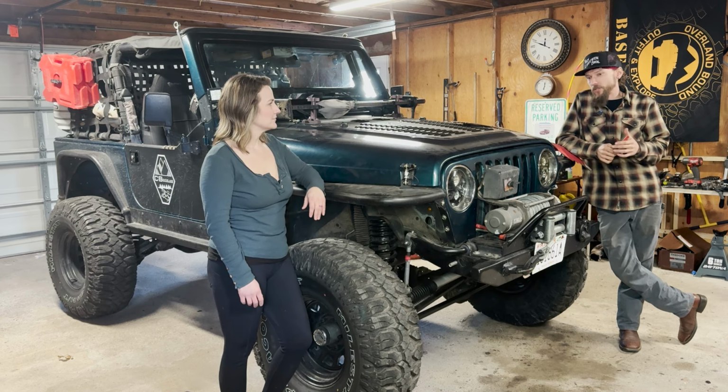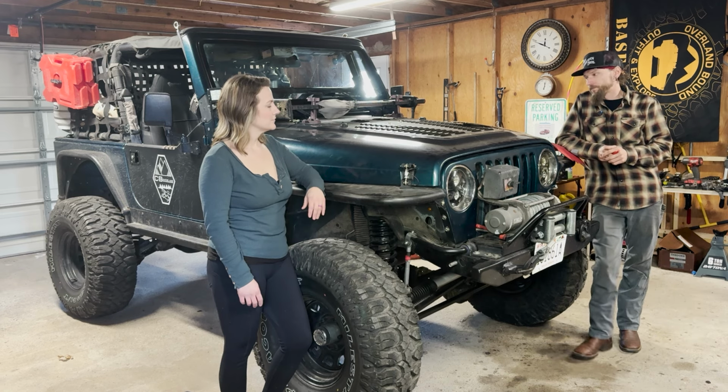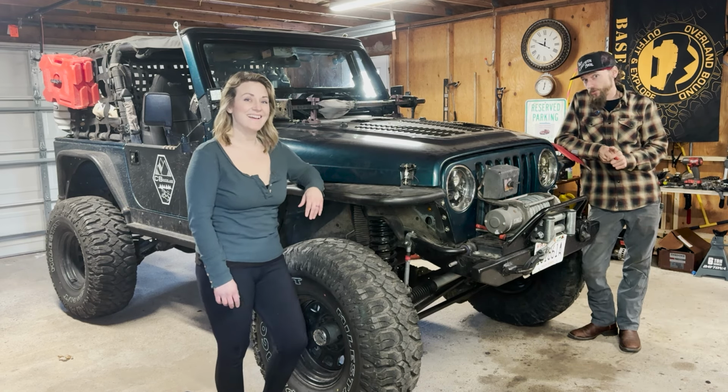Behind the transmission, the transfer case was a relatively recent rebuild. It's still a 231J. It's got a slip yoke eliminator on it. That's only got maybe 5,000 or 6,000 miles on it. So we'll just give that a fresh fluid change, and all should be well in there. We'll definitely check the diffs. Give that some dinosaur juice.